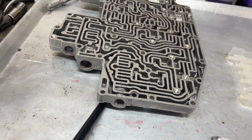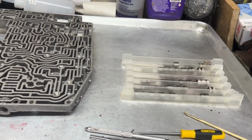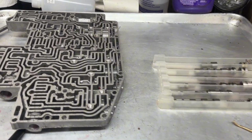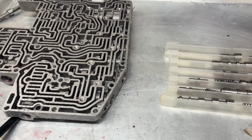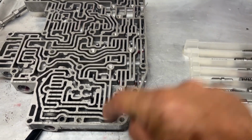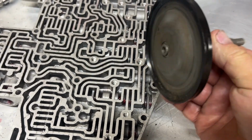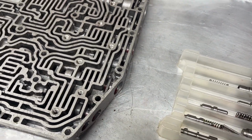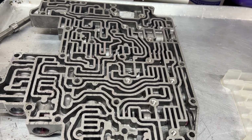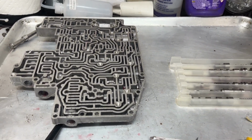So I'm going to end this right here. This is going to be a long enough video as it is, and then I'll make a video of me putting this in the transmission. I need to do a couple things first. I got to put in the reverse first gear servo pusher inner thingy. There's a spring that goes on it plus a cover. And I got the overdrive servo to put in there, 2-3 capacity or accumulator or something. And then the valve body goes on. So that'll be in the next video.